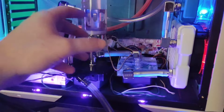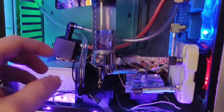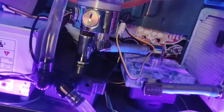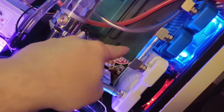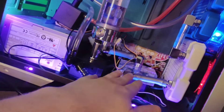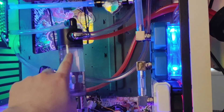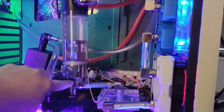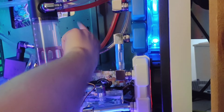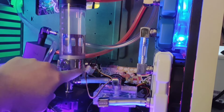Obviously it's kind of messy — there's wires everywhere — that's not how I plan to have it for the final build. We have two pump mounts now, so we can take both of our DDC pumps at the bottom and mount one to this radiator and the other to that one, so they'll be sideways. That'll clear up this space down here to probably have the other two pumps side by side, and then I'll have basically two reservoirs — one on top of the first pump.